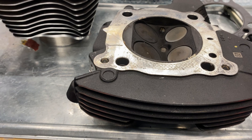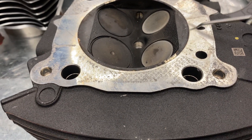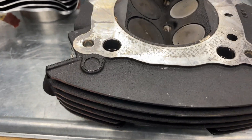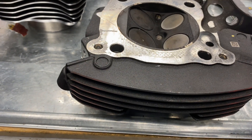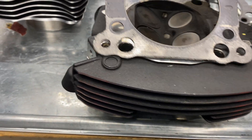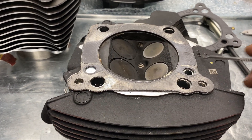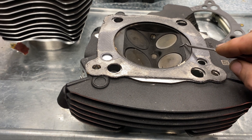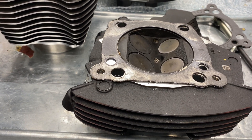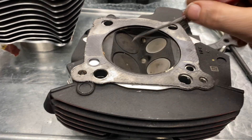This is an air-cooled V-twin — we don't have a cooling system. Some do operate on the exhaust side with an oil feed area to try and cool things down. In this case, on this 117 built to a 131, this didn't have an issue — it's just a reference. But when these let go, you're going to see oil pissing out the back. Oil can also retract inbound through the four-stroke cycle — on the down momentum of the piston, oil can suck in and get contaminated with combustion.